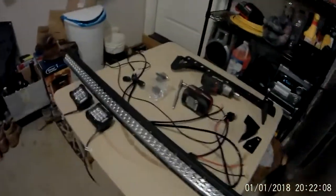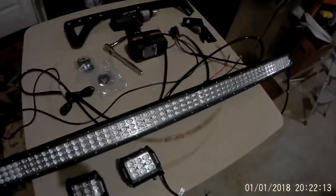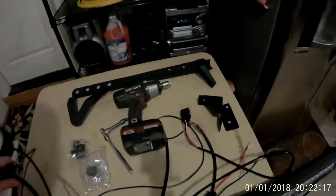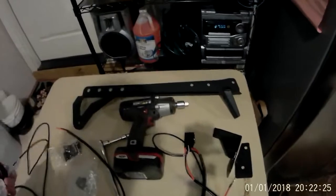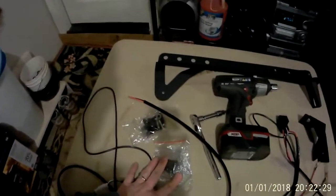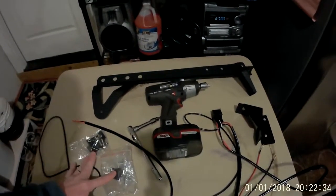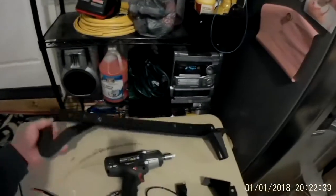Here are the contents so far: the two pod lights, the 52 inch LED light bar. It comes with just one set of wires and has a built-in relay — I think it's a 40 amp relay — that runs the switch you can run inside the cabin. It comes with all the bolts to mount the lights with the brackets. Again, you will reuse some of the A-pillar bolts when installing this bracket.